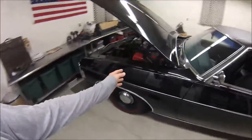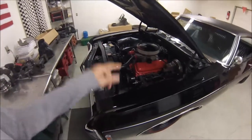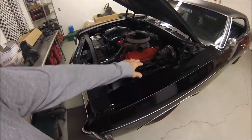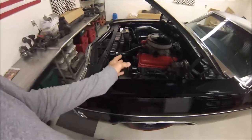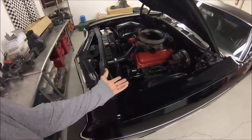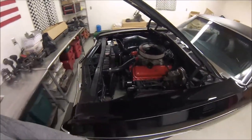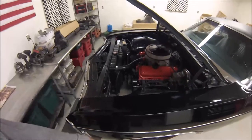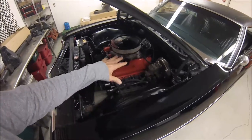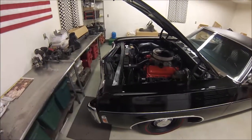Moving back from the motor — I did have to change the oil pan on this motor because it came with a truck oil pan. These cars in 1969 were what's called rear steer, where the tie rod is actually behind the crossmember, so you have to use a Chevelle pan on there, which they make for the 502 block. I had to buy that from Chevy and put on the passenger car pan instead of the truck pan. Once I did that, everything bolted in fine. I sourced the clutch pedal, Z-bar, and clutch linkage — all of that came out of a '68 Biscayne I found in a junkyard with the three-on-the-tree, and it all bolted up.